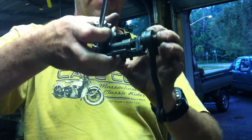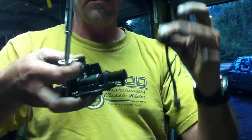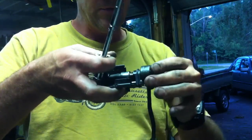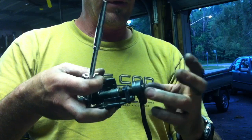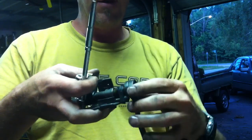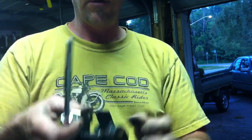This will slide in and out as the shifter moves back and forth — this needs to slide. It's not supposed to be pressed on there, it's not supposed to be stuck on there. Spray some lubricant on both sides. I tapped it with a little hammer, a small bodywork hammer — tapped it on the bottom in and out. You'll eventually get that moving, grease it up, and you'll be good to go. It will go back over into fourth and then shift down all the gears.